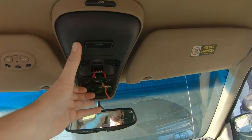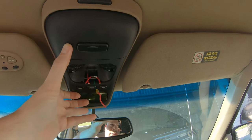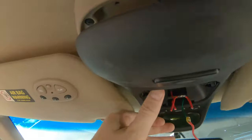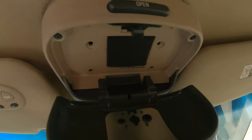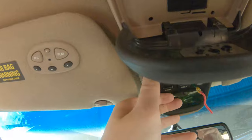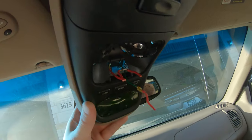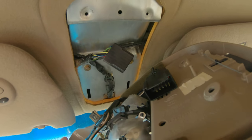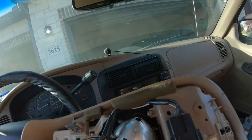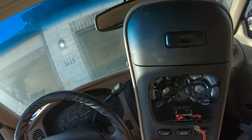All right, I figured I was going to go ahead and remove this map compass console thing. And to do that, it's pretty simple. I already got it going here, but I'll just demonstrate. You open up the sunglasses thing. There's two Phillips head screws. You remove those, and then you can reach up to the front and yank down, and that comes loose. And there's a cord or a cable. We're going to detach that cable, and then the whole panel piece comes down. So yeah, this is what it looks like removed